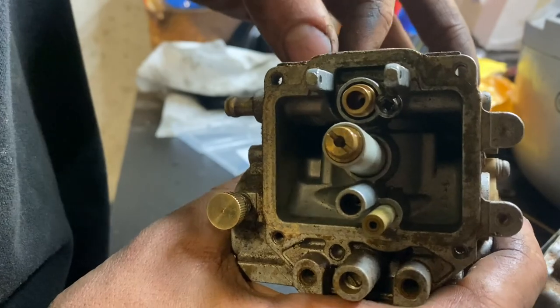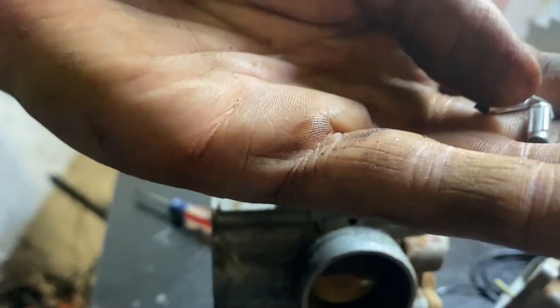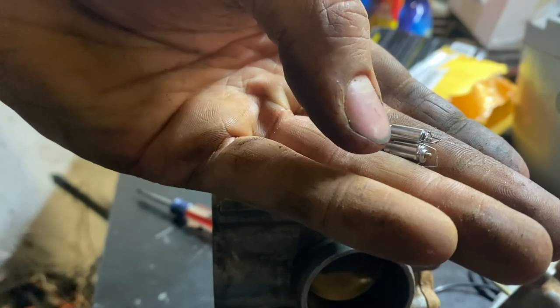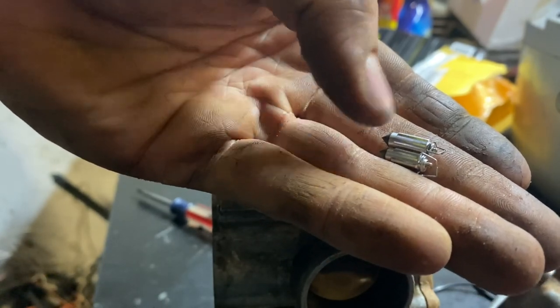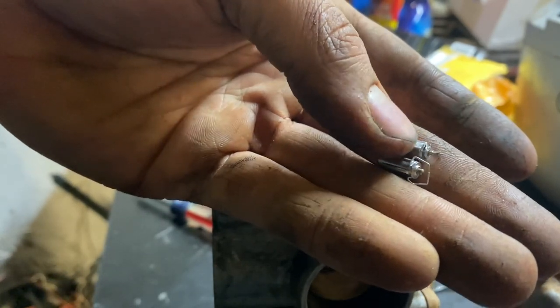You can't really see it but the seat isn't corroded or anything. This is kind of unfortunate — I got a little ripped off with this rebuild kit. You can tell the factory needle is on top and the rebuild kit's is on the bottom — the factory one is a little taller. Let's hope it's just the float height that's causing the problem. I have a feeling it probably is.